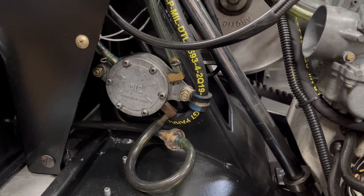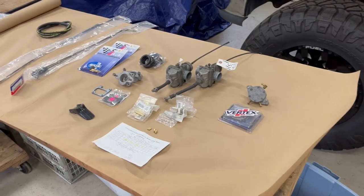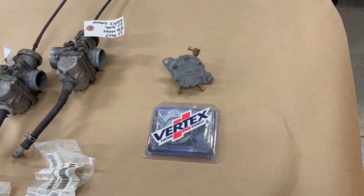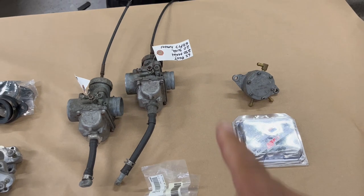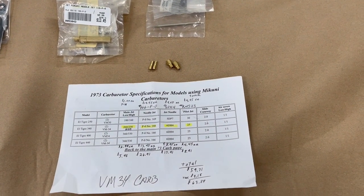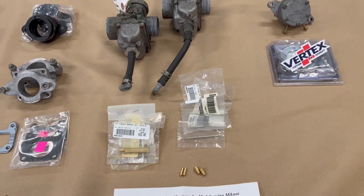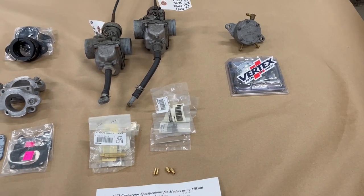There is the Mikuni Dual Outlet Fuel Pump — same pump that I'm going to be using in Rat Cat. Here's everything laid out on the table. We're going to go into this in detail in the description with all the part numbers and where you can buy everything. I picked up a dual outlet fuel pump and its respective overhaul kit from Vertex at a swap meet. You can buy these pretty cheap from Dennis Kirk. I have a pair of VM-34s. I did take them apart and note the jets, but I purchased all of the jetting for the 1973 engines used in the El Tigre. I've highlighted all the jet numbers, so I have purchased pilot jets, main jets, needles, and needle jets to go into these VM-34s. I may have to pick up a gasket yet for the bowl, but I have everything I need to clean these carburetors and jet them identically to my Puma engine.